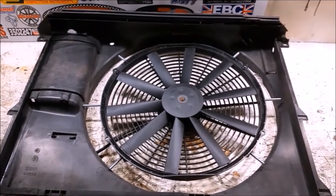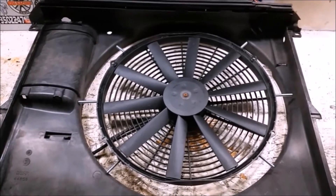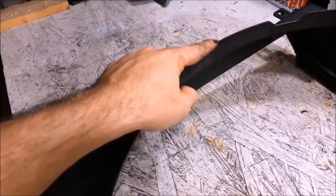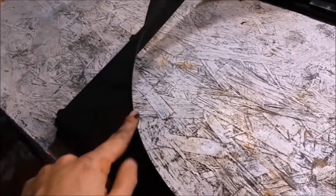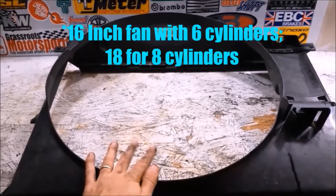Here's our fan sitting in the shroud. You can really see how an 18-inch fan would easily fit inside there. The way I plan to mount it is with six different bolts all the way around the edge — these ones are going to be too short, I'm going to have to step up to one that's about a half inch longer. There are little grooves all the way around — six of them — and you just take the head of the bolt, slide it down in, press it tight, and then you have mounts all the way around the fan. On the shroud there's a little dip, so I can mount the top four but I'm going to have to make brackets for the bottom two using some aluminum, just to make sure the fan stays in place. For the V8, you could definitely run an 18-inch fan.